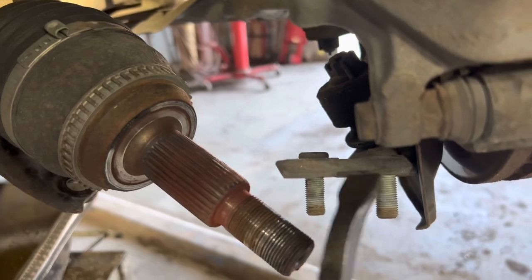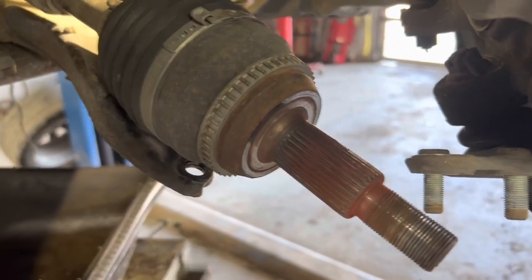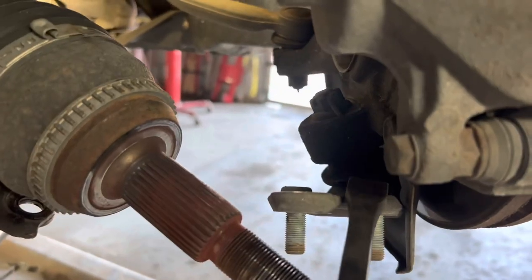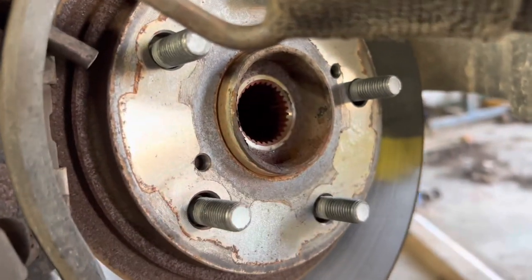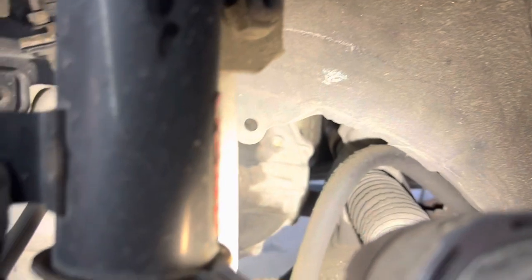We finally got parts here after a day or so. I'm going to start ripping on this and take you along for the ride. These are pretty simple, because you see the ball joint is bolted to the lower control arm over here — that means you can just zip the bolts out. You don't have to worry about popping the taper right there. Big nut, pull it out. These just push out; you don't have to press them or hammer them. This part is usually pretty easy.